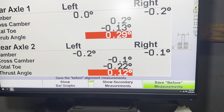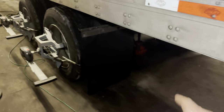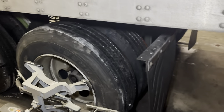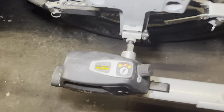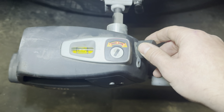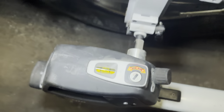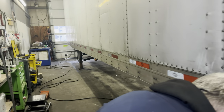Save the measurements. We'll try to move it to the middle — this is the rear axle right there. Make sure you start like the instructions say. You have to set these bubbles in the middle and secure it. After you set it you secure it like this — you have to do it to each sensor, on each side.